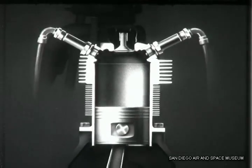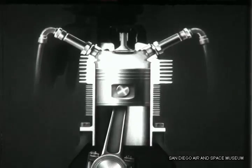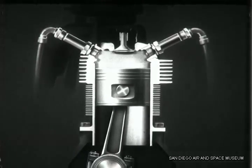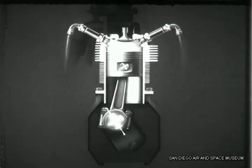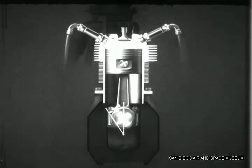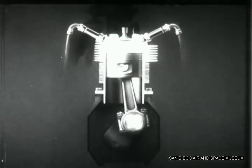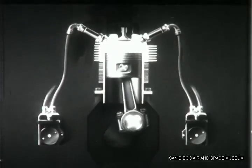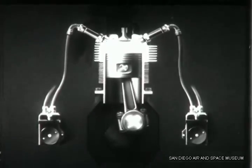And here's an important point. The spark must be delivered slightly before the piston reaches the top of the compression stroke. This is to allow a time interval for the mixture to ignite so the peak of expansion occurs when the piston is at the beginning of the downward stroke. Since the piston drives the crankshaft, this distance before top center at which the plug should fire is measured in degrees of crankshaft rotation. The number of degrees varies with different engines — in this one, it's 30 degrees. The sparks are manufactured by the magnetos and controlled by the breaker points, so the breaker points must be timed to open and produce a spark at the exact instant when the piston is the correct distance before the top of its compression stroke.